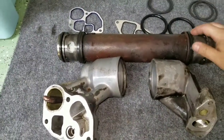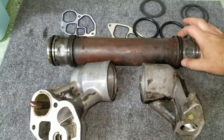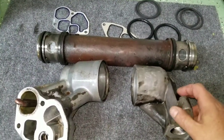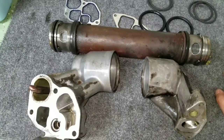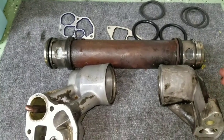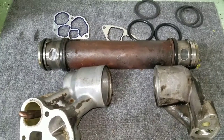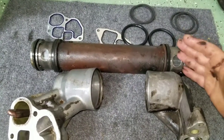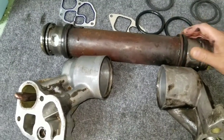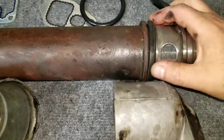Here we are — this is my oil cooler for my '73. I had a leak coming from the front, which is right here. I was trying to figure out what was going on; I couldn't find the leak. I was looking everywhere and it would leak very badly in the morning on cold days. Basically, the O-rings were worn out, as you can see.